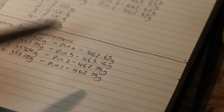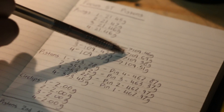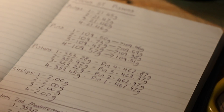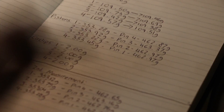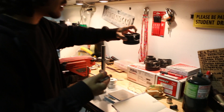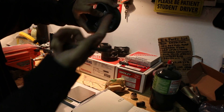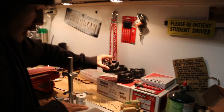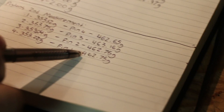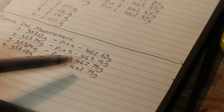The pin numbering was based on their weight relative to each corresponding piston. We put the heavier pins with the lighter pistons and the lighter pins with the heavier pistons to even everything out before we started. With that in consideration, we organized them accordingly and then measured them on the scale. Here are our total measurements for the pistons and pins.